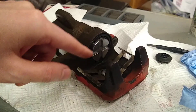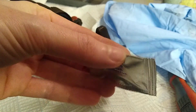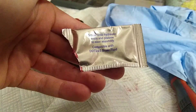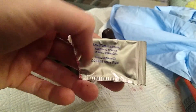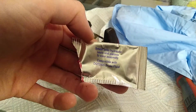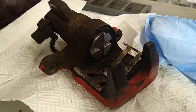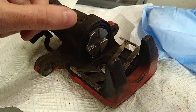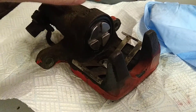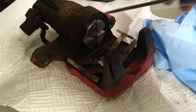After about two hours trying, the way I ended up doing it was putting in more grease. You get this red hydraulic assembly paste — which is compatible with brake fluid, not copper slip or anti-seize, specifically designed for going on the seals; it's a lithium soap based grease. So you grease up the piston, and I put the seal into the caliper housing first, making sure the seal was home in the groove all the way around. You can carefully work around it using a blunt screwdriver to tuck the seal in all the way around.